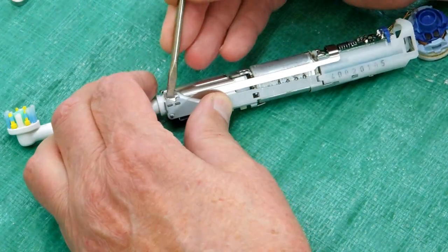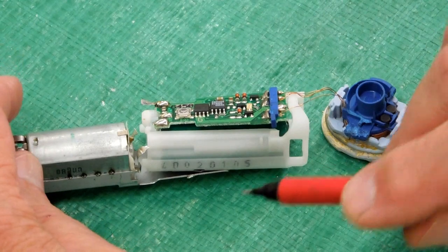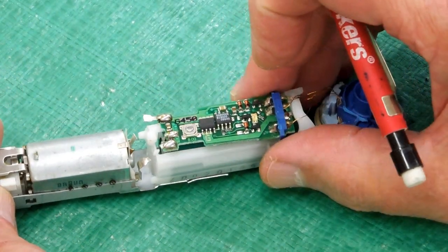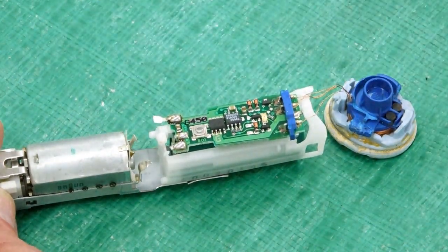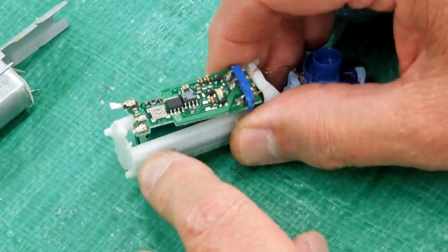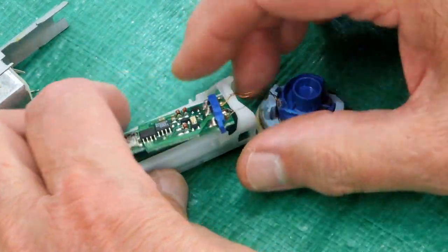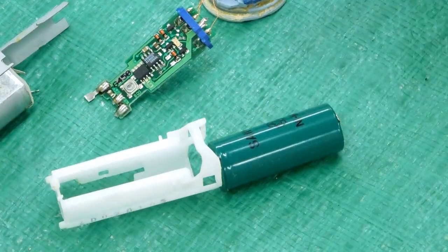Remove that arm for the switch. Released a couple of detents on the battery pack so I can slide it back. There are two straps going to the motor, which I cut loose from the circuit board. There was also a strap from the battery pack to the circuit board and one at the back. The circuit board comes off and the battery pack comes out.